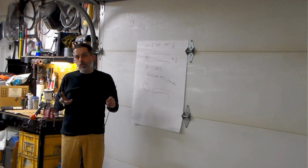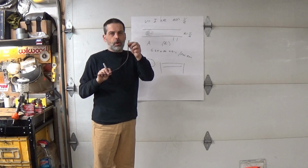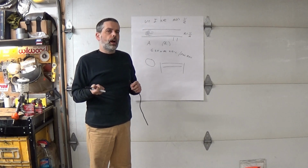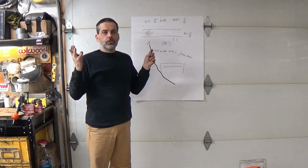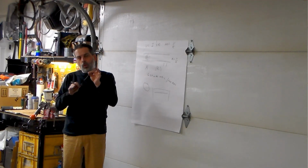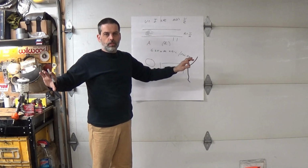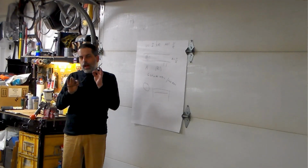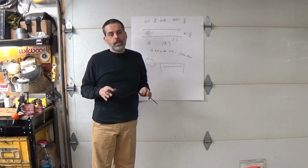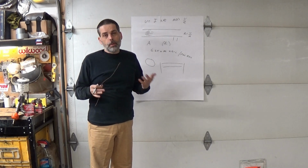And I actually had that happen to me once, where on some of the battery cables, the ground has a very large diameter wire, and it's got this smaller diameter wire to go to another ground portion of the circuit, but it's not part of the starting system. Well, I was trying to start a car one time, and it wouldn't start, but I had smoke coming out from under the hood. And when I looked under the hood, I saw that this wire was fried because there was a break in the battery cable ground wire somewhere in the length of it. And when that happened, this wire was trying to serve as the ground for the starting circuit to start the car. So again, it's really important. This is why you've got to change the wiring. Don't leave the wiring in place if you're going to do this kind of upgrade, because you're going to fry something and probably start a fire in your car.